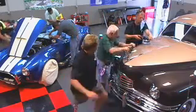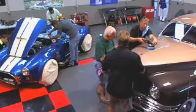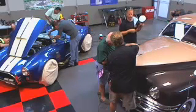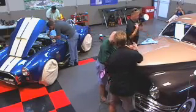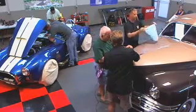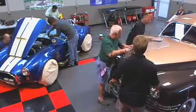How's that feel, Wes? I can't believe how easy it is. Now, one thing I want you to notice, you want to make sure that pad's rotating, see? Now look what happens when you tilt it too hard to one side. So that teaches you to hold that pad flat. Don't lift it up, whatever you do. Now go ahead and turn this off. Let's check your speed setting. Turn to 5. If you bump that up to 6, you'll see that thing rotating a lot better. Now try. There you go.